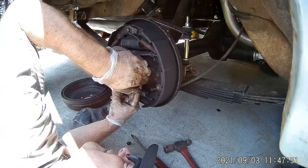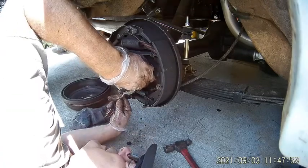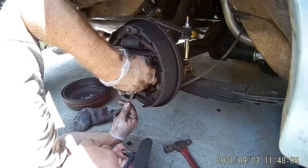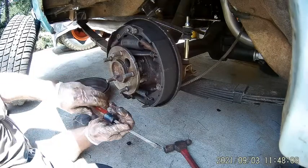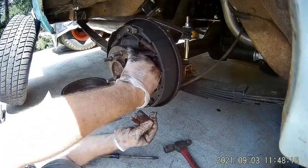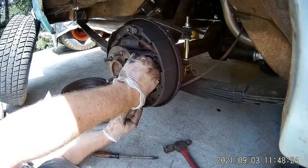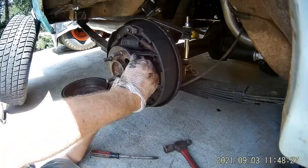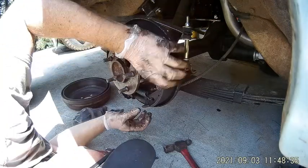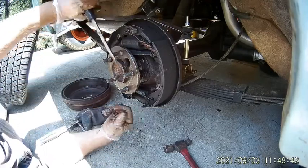I'm going to have to back up just a little bit anyway. There we go - that's perfect. As everything starts spinning and the bearings settle back in after all this messing around, both sides will have just a touch of play in them. Tolerance will open up - you just don't want to put them super tight. If you preload them, some people say to preload, but if you preload you run the risk of burning out the bearings.